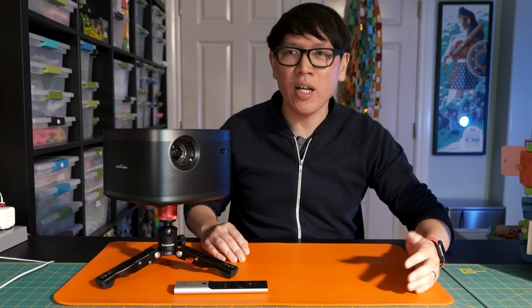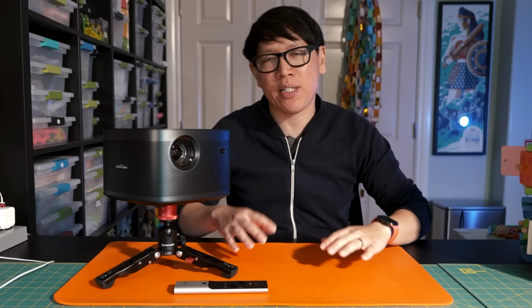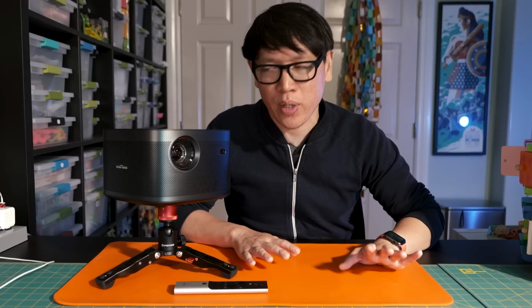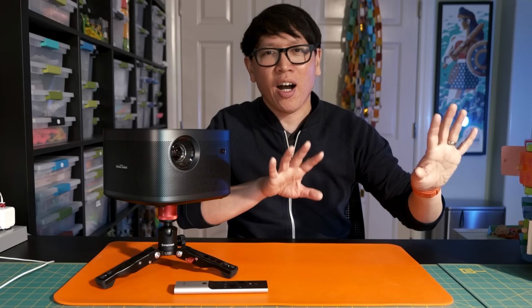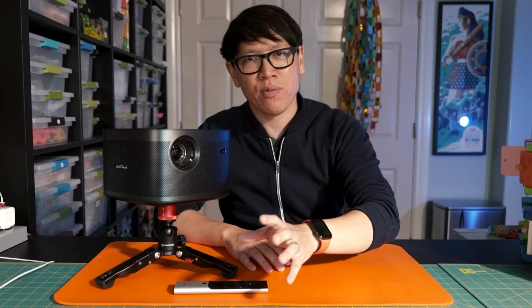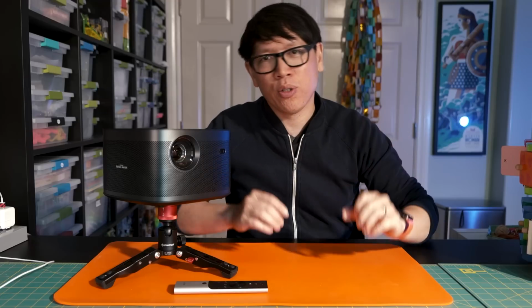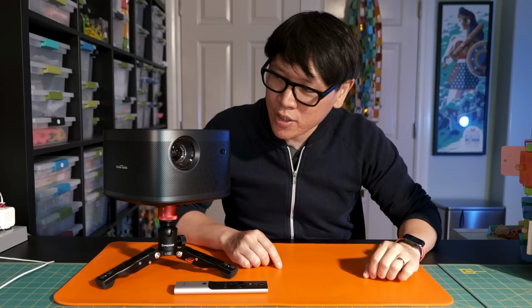relative to your screen, although you do have a little bit of flexibility because you could move off axis up to 40 degrees. Though I found that when you get past 30 degrees or so, you're going to get uneven image quality on the parts of the screen that are closer to the optics versus the parts that are further away, that you adjust via the keystone adjustment.